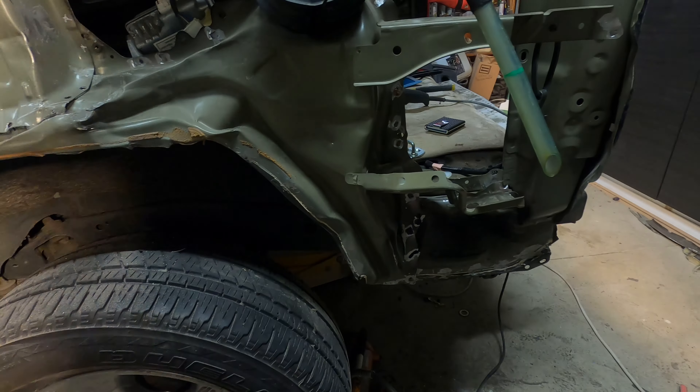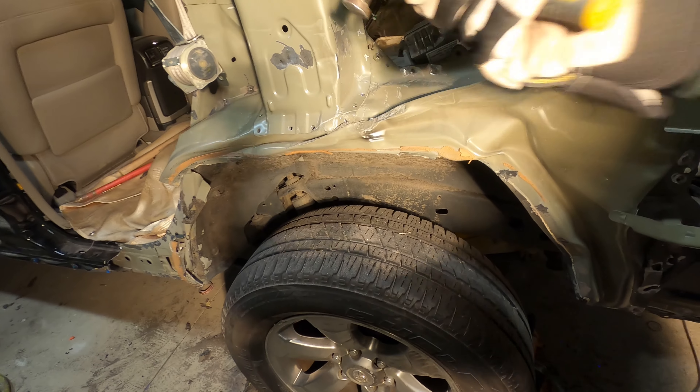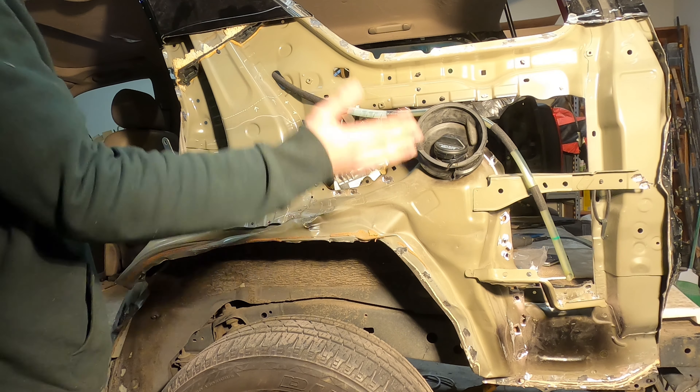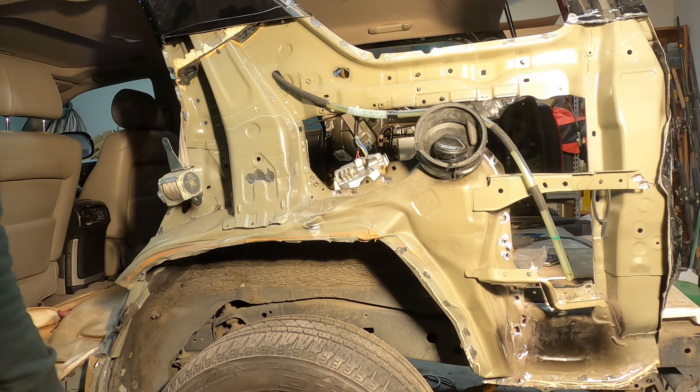We got this section off. The only thing that's holding this in is going to be a couple of spot welds inside that have to be drilled out. So we're back inside of the car — we have one, two, three, and four to drill out here and this panel will come off. Let me get these four drilled out and let's take this sucker off. I'm just going to use the putty knife again. If it doesn't break loose, I'm going to drill the holes a little bit bigger. Let me just do that and this piece should come off.